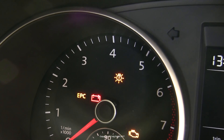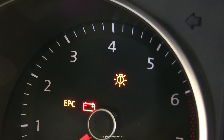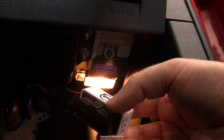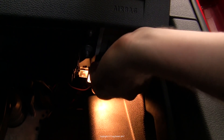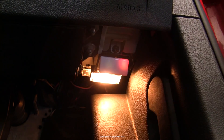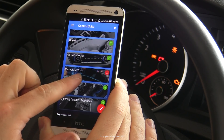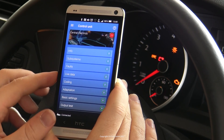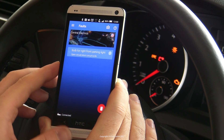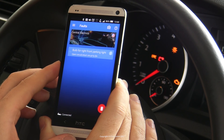So you need a Volkswagen-compatible scan tool, and we need to do a little coding in order to fix this. Here I'm using OBD11, but of course you could use the traditional VAGCOM and VCDS setup. Just to check the module errors, you can see here the bulb-out error: open circuit / short circuit to B+. That's what we expect, and there's no point clearing it just now as it'll just come back immediately.